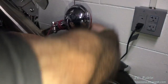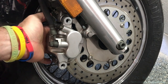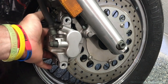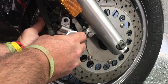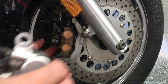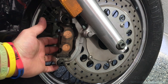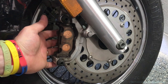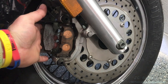I'm going to wrap that cable a couple of wraps around the turn signal. Then I'll bring my hand around the caliper and hold the brake pad on the back, because once I remove the caliper there's nothing to hold that brake pad — it's just going to fall out onto the rim or onto the floor. With it secured, I'll bring the caliper back and right off. You can see my finger is still holding on to that brake pad. As I pull my fingers away, that brake pad is just going to fall right off.